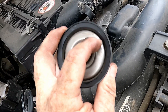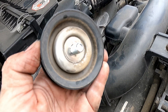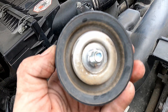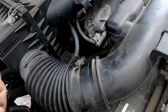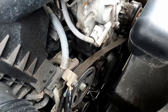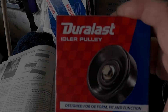It was making some squealing sounds and as soon as I shot some WD-40 into it, it quieted down, so I know it needs to be replaced. You could just keep lubricating it and hope that would work. It may be a sealed bearing inside, but I'm going to go ahead and just buy a new one — it's about 64 bucks at the local parts store. Also, looking at the belt, it's kind of discolored and it's got some minor cracks in it, so I'm going to go ahead and change out the belt while I have it off.